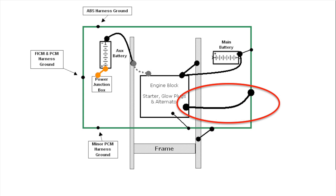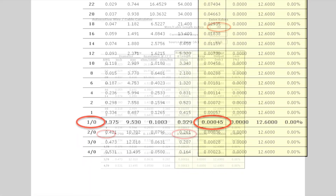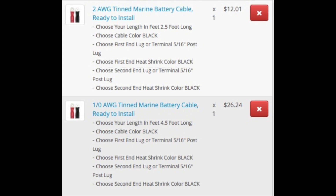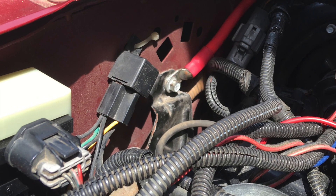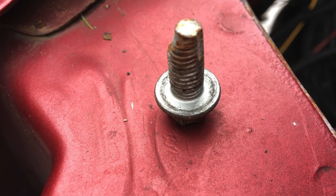The typical routine is to add a cable from the alternator to the fender, running against the firewall, so the cable is about 54 inches — typically a 1-aught cable for low resistance. I didn't have that, but I have a shorter 2-gauge cable, which actually has less resistance because it's a shorter length. Going long not only adds more cost, but you have to increase the size of the cable due to the longer length. Electronic engineers always go for a shorter distance when they can. The connection mounts to the commonly used fender bolt — a welded nut situation like the designated grounding points, but with a connection through a bracket. The bolt is self-threading like the grounding bolt, so it has good engagement.